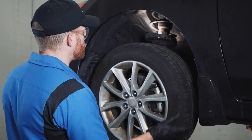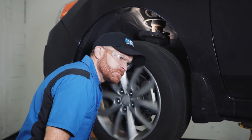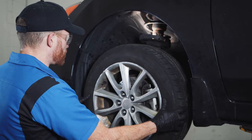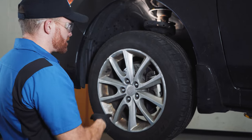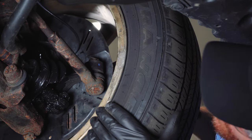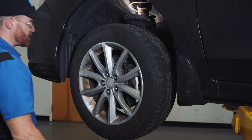Safely raise and support the vehicle. We'll take the wheel and give it a quick spin. I'm listening for a humming noise coming from the bearing — I hear a little bit but it's not horrible. We'll take hold of that wheel. Wow, there's definitely an issue here. I can see movement in this area, but I definitely want to check that tie rod as well, so I'll give this a quick shake. I got no movement from that.